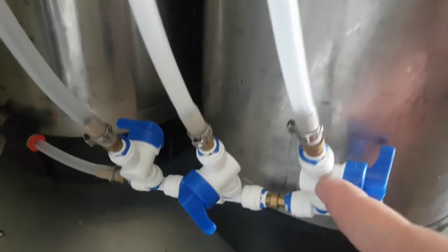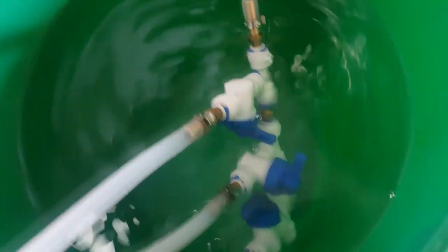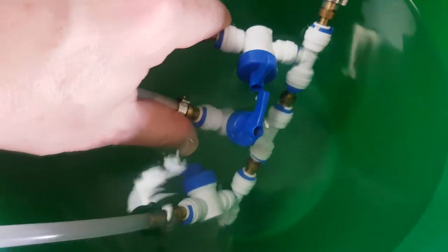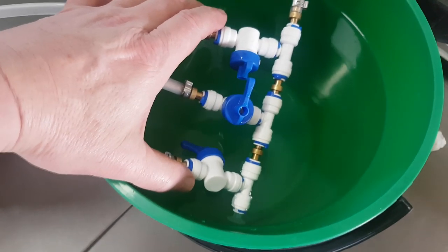I use these old blue and white fittings — I'll show you in a second. I know if you have the door pressed on them, sometimes they can leak. I've been using them for a long time quite successfully, but I just think it's time to upgrade. I'll give you a quick look at these and we'll see if I can wiggle them and show you how they leak. They've served me well for years, but they're touchy. Put them in water and you just sort of bend them a bit. If your fridge door hits them when you shut it, you can lose gas. I've been very careful over the years and these have been fine, but it's time to change them.